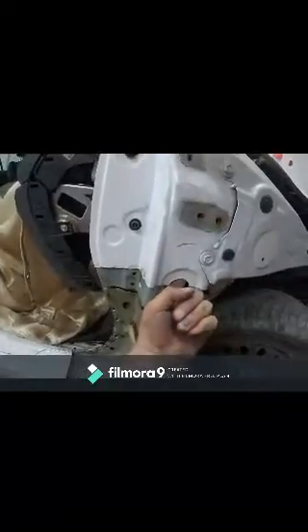Back on the Honda Accord — we're going to show you what we did. We removed the inner structure, which is this piece, and this inner structure piece will end up fitting in here like that. Now, if you can see here, this is in, so that means I've got to go in behind and pull out so that it meets before I weld anything up. Then this would be the outer skin, which will go on there like that. Then I will need to cut it here, butt weld it in, and then away you go.